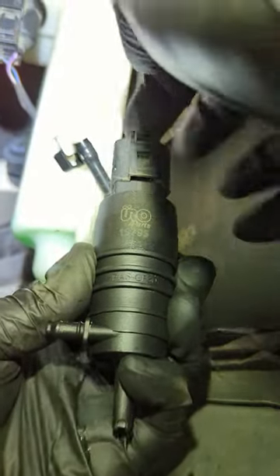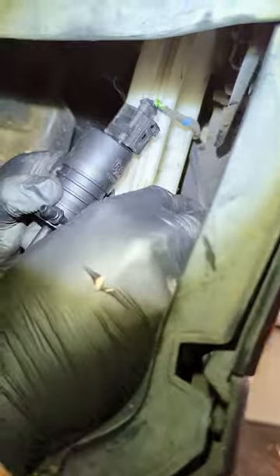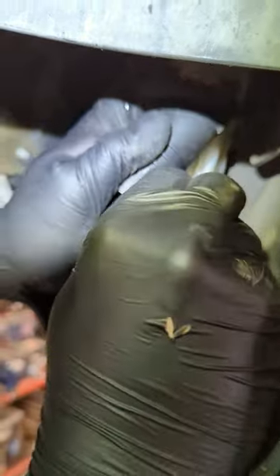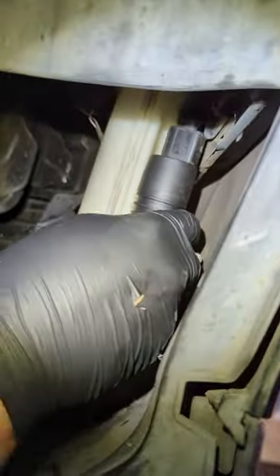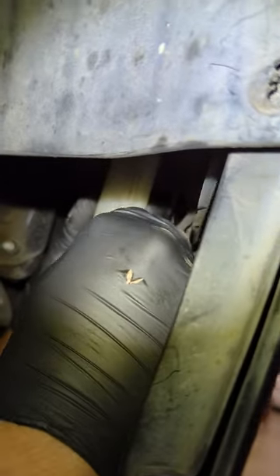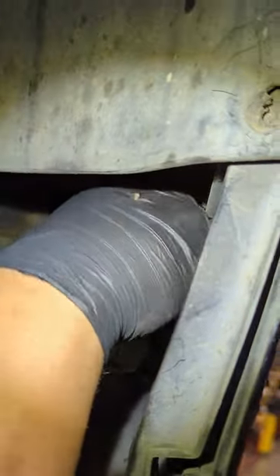Now we're ready to put the new pump back in — we're just going to go in reverse order from what we did before. First we'll put the connector back on; you should feel it click right into place. Next we'll put the washer hose back on — that connects to the outlet popping out on the side. It's a little hard to see since it's a cramped space, but you plug it back in and then there's a little U-clip that you slide back into place. Once the U-clip is back in place, the hose will have a very hard time coming back out. The only thing left is to stick the pump back into the grommet — make sure you get it in there nice and tight and all the way down.